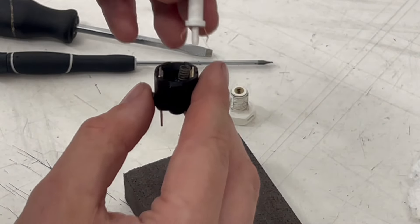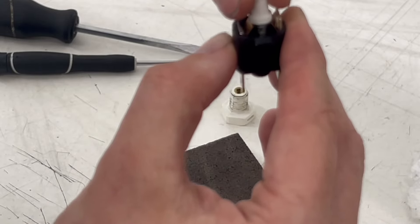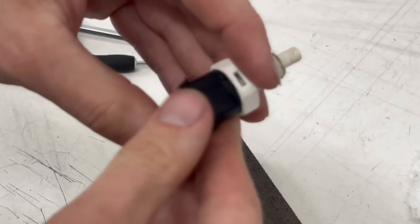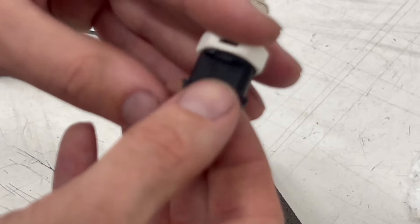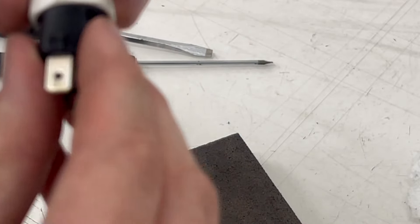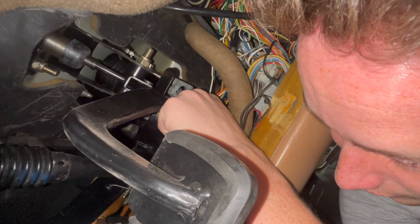So I'm going to thread some paper towel through here and get that all wiped out as well. Just doing some very light sanding because as we sand, we're taking away material, so I want to be careful not to take away too much. You can see that's now perfectly clean without really taking away any material. Slide our pins back in — it's such a simple switch. Check this, make sure we can feel it making contact, and slide over our knob.